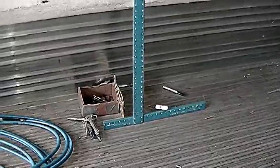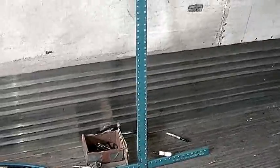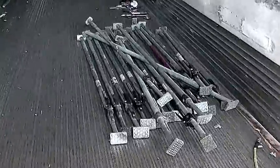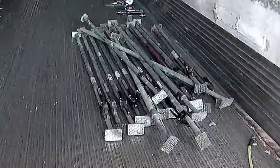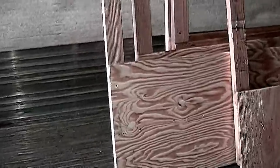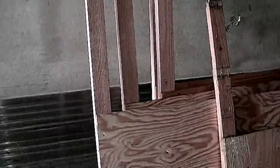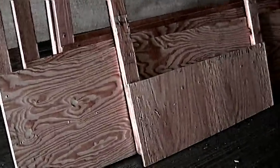A 48-inch sheet rock square is good to have so that you can get straight lines that are square with the floor of the trailer. Lots of load locks will help keep the new panels in place until the adhesive sets up. For faster results, build wall presses out of half-inch plywood panels and attach 2x4 adjustable legs so that they will stand above the scuff plate. This will save man hours and result in a better quality panel repair.